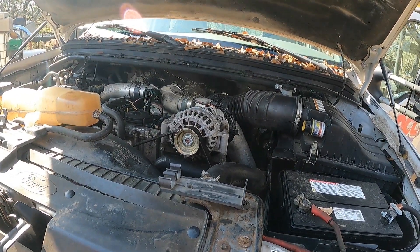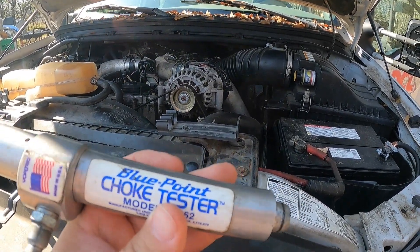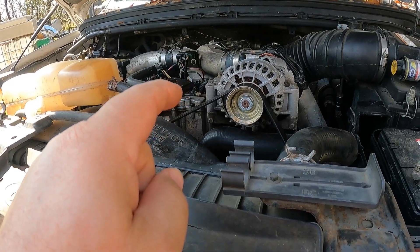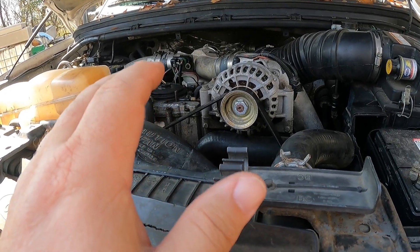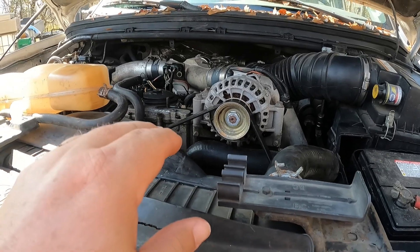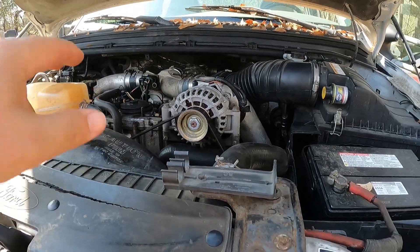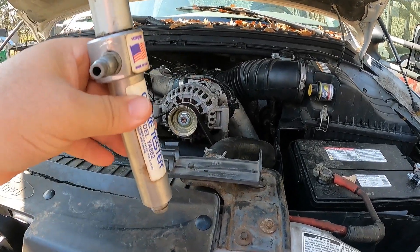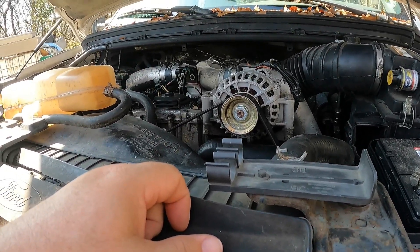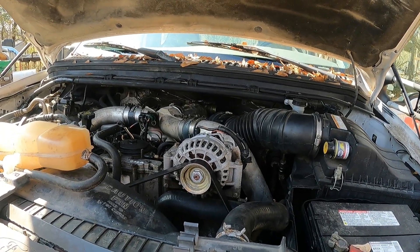That takes care of this one. I'm going to pick back up when I get to changing the IPR - I just wanted to show y'all how to test this. If you have an old school mechanic that still fools with carbureted stuff, they may have this choke tester you can borrow. You could also put a blow tip from shop air and cool that coil off, or you can wait an hour. The reason I went to testing with this is it would die and take 45 minutes to an hour before it would crank back. On another truck I kept thinking it was the crank position sensor, but that tested fine. With this tool I can blow hot air on the coil and make it cut out, or blow cold air and make it come back on - temperature-related coil breakdown. Hope that gets you guys out of a jam. Thanks for watching and we'll see y'all soon.